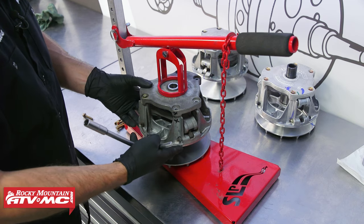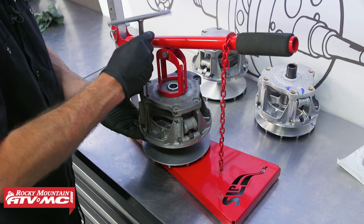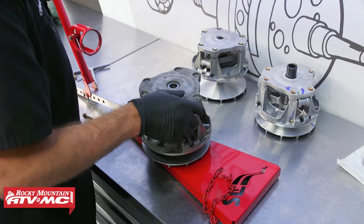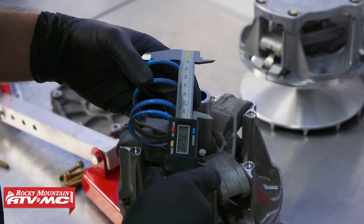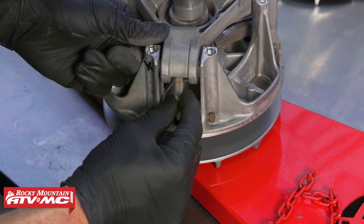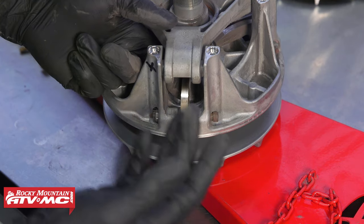If for some reason you're going to be reusing this clutch, keep a hand on the upper sheave so it doesn't drop when you remove the last bolt. Once done, release the spring pressure and remove the cover and the spring. The manual should give you a spec for the free length of the spring to determine if you can reuse it. Before removing the weights, point out a couple of common inspections: if you have a lot of side-to-side play, or any flat spots across the top where it rides against the roller, get them replaced. If it looks okay, you can go ahead and reuse it.